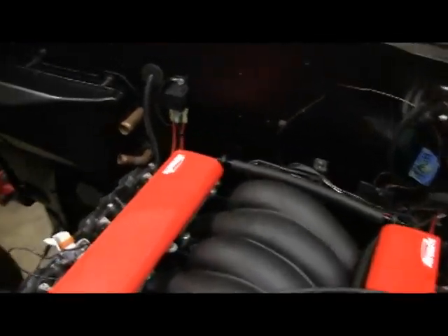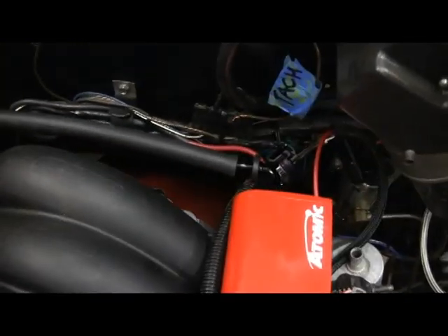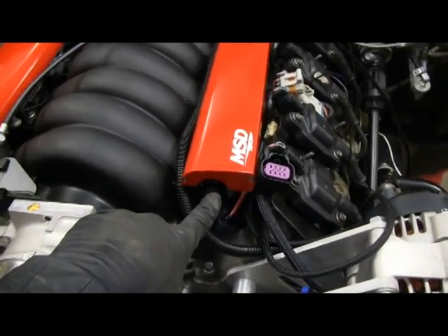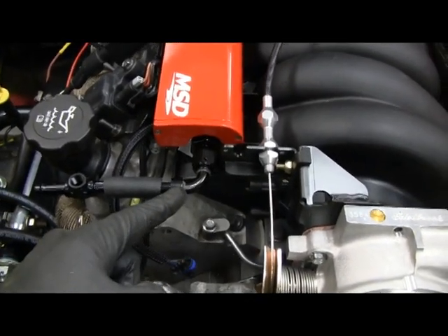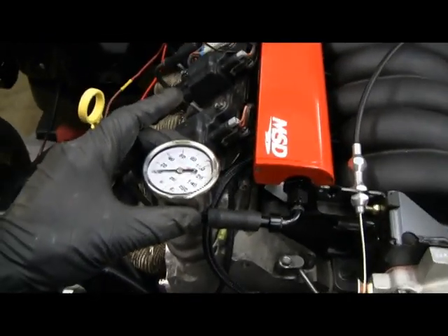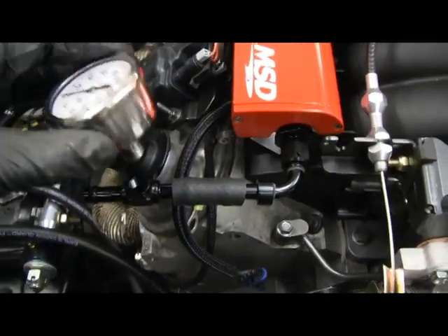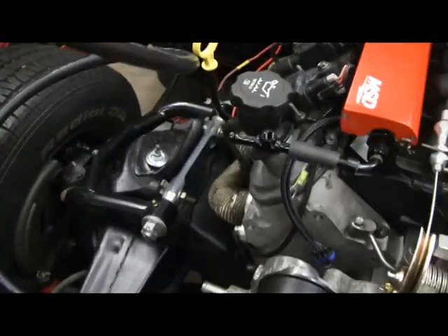I mocked everything up from a fuel system standpoint. In the back I can put in my transfer tube from one side to the other. In the front I'm going to cap one port off — I don't have a return system; I have the pump in the tank, so you don't need a return with that. My feed line will come off the front, and the pressure gauge will go in there — though the AN fitting I have is too small for the back of the pressure gauge, so I'll need a new fitting.